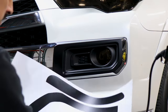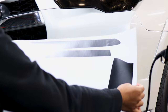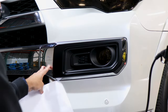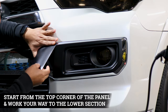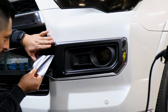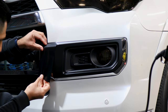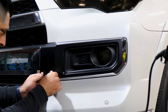Now that we've finished installing this piece, which would have been here in the middle, let's continue on with the rest. This one is going to be for this part of the film here. Start off from the top portion and align it on top, then little by little bring it down. Make sure as you're going down it's still covering the side edge here. Tug the film a little just to have it straight so it's not going to move on you, then just start squeegeeing it little by little.